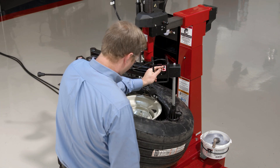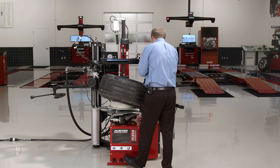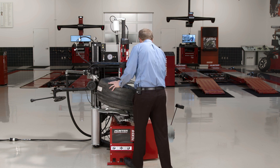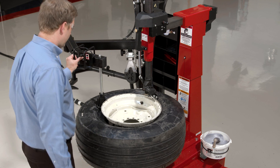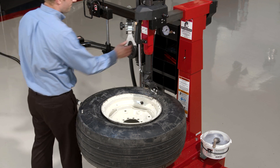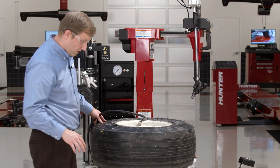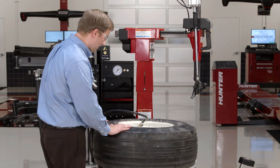Again, I'll want to deploy my press arm this time as a press device to keep this tire not only in the drop center, but it has a nice point to establish traction here. Make sure that it stays inside the drop center all the way around. Now I've got this tire all mounted up without sweating. So I'm ready to go ahead and inflate normally — again, 40 PSI max, and anything in excess of 40 PSI, you need a safety cage.